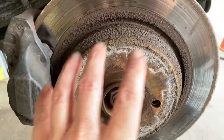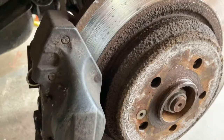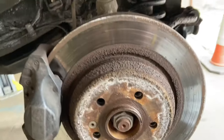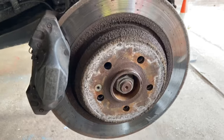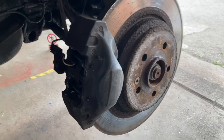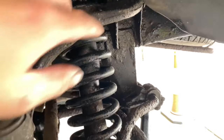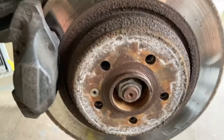While I've been on, these are your internal brake shoes within the disc for the handbrake. Got some high-pressure air and blasted all that out of there just to stop things getting wound up. A bit of copper grease here — there's nothing wrong with copper grease around these to stop the alloy wheels getting stuck on. Just use your time wisely: if you get the chance to use a lift or you've got your wheel off, do as many bits as you can. I've also greased up the chassis a bit where you can't get to with the wheel on — just on the shocker and spring as a bit of corrosion protection.